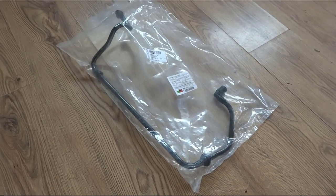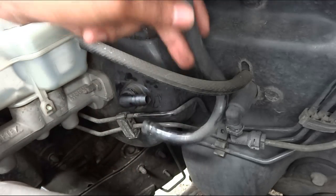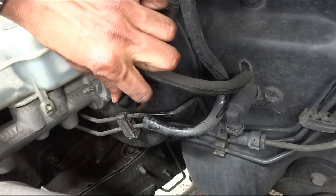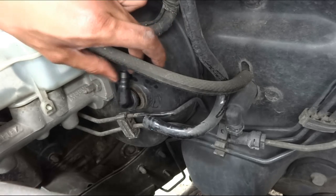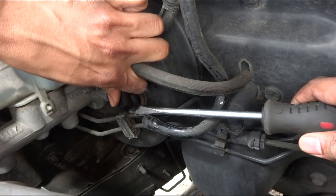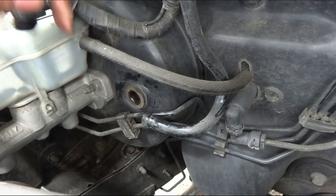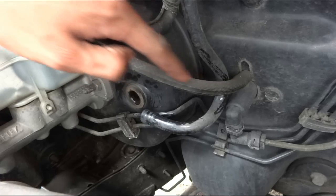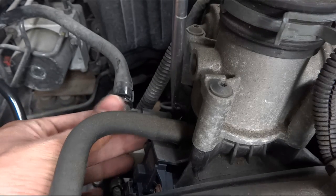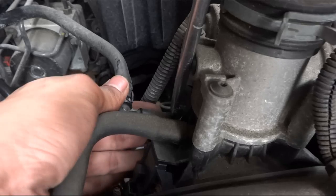So we're by the brake fluid reservoir. To take it out, I just removed this, then rotated the connector like that, and just took a flat blade screwdriver and pulled down on that side and then pried up — but be careful of the brake lines. Then it just popped out. When you put the other one back in, make sure it goes behind this, as it was from the factory. I'll put the flat blade screwdriver behind here, get some leverage, and wiggle it out.